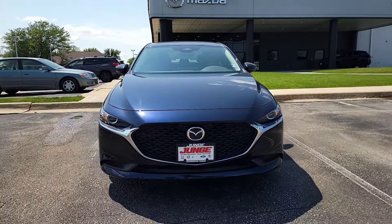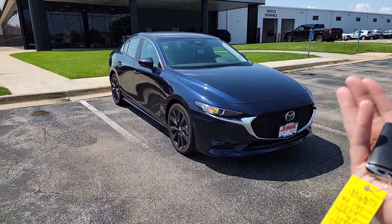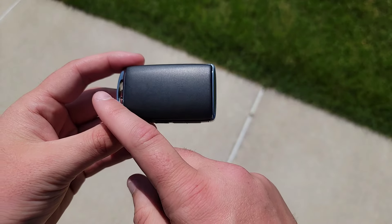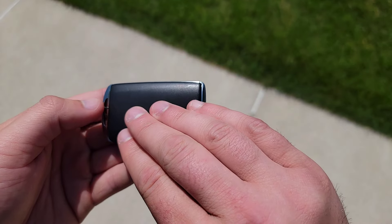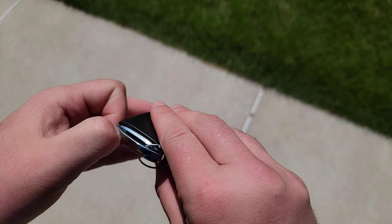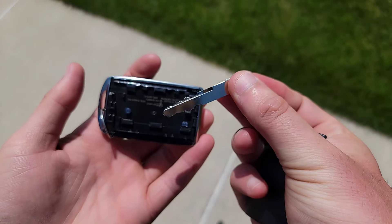Let's imagine you're out there running to your vehicle and you hit the unlock button only to discover your car's not unlocking because of one of two things — maybe the car battery's dead or maybe the key fob battery's dead. You have stuff in the vehicle that's not unlocking. How do I get in there? Well, I have a way. First step: grab your key fob. You're going to notice there are multiple sides — a black one with a Mazda emblem on it, and then the plain black side. This is the lid where the key is going to be. You'll also notice there are chrome action buttons versus plain buttons. Once you hit the release, you're going to slide this cover back towards the button side. The release is up here on the top. Pull it towards the buttons — pops right open, and there's a key.